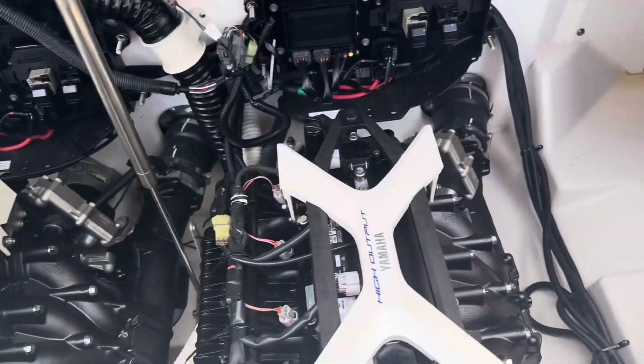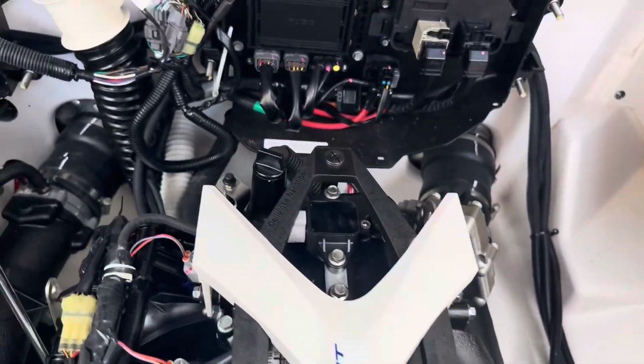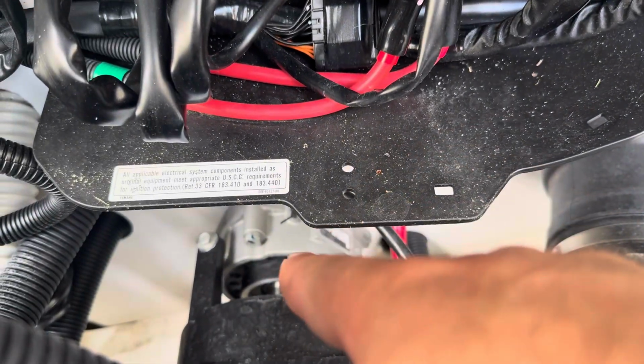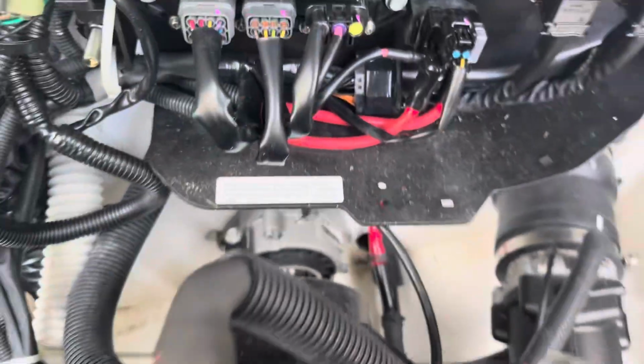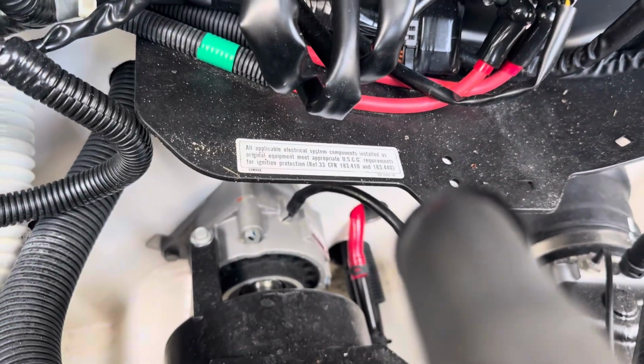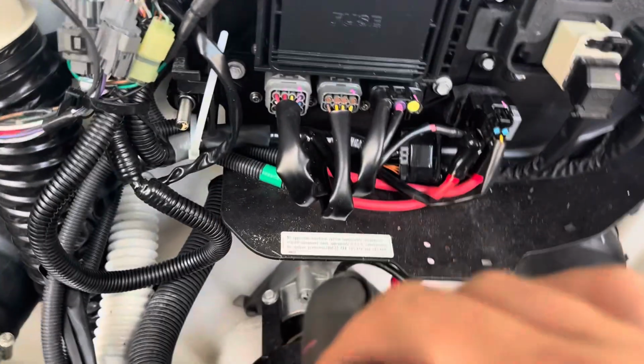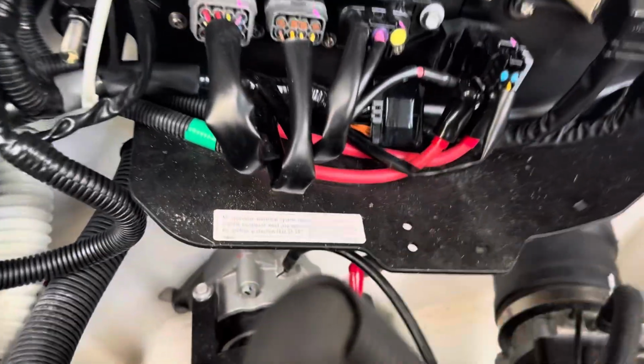All right, here's the engine compartment at 100 hours. So the intermediate shaft bearings are there, and they require greasing at 10 hours. Well, they require being filled with grease at 10 hours. It takes 33 to 35 cc's of grease. They come empty from the factory. They want the factory to do it at 10 hours. So I filled mine at 10 hours